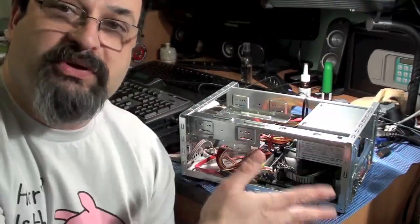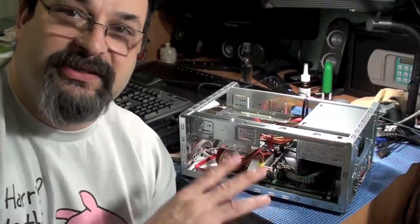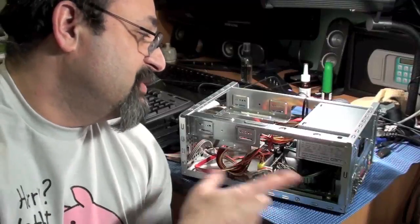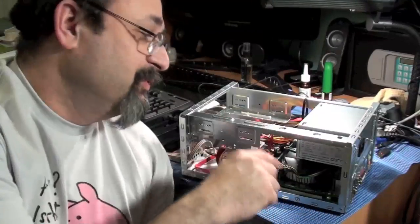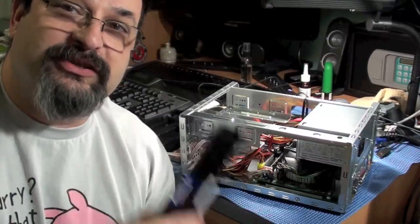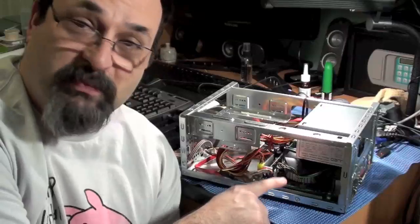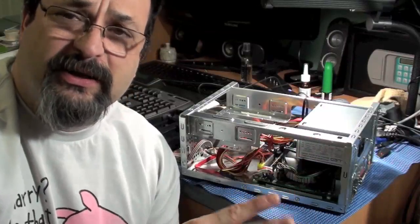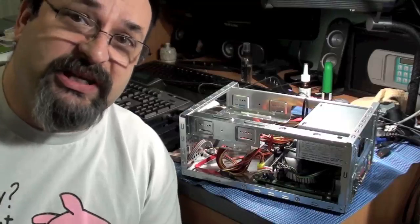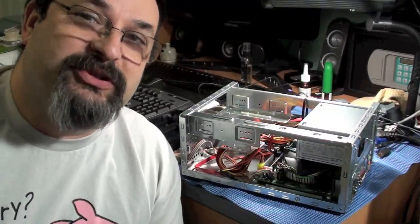So in the case when I built this, I did everything on a 1066 speed based on that front side bus. So I had a front side bus speed from the chipset of the motherboard to the processor of 1066, and I bought 1066 RAM, which is the maximum supported by this motherboard, even though you can overclock even further. I don't mess with overclocking because I want to build a stable system. I'm not a big gamer, so I'm not trying to squeeze out every ounce of performance.